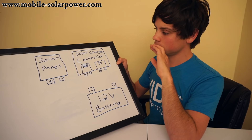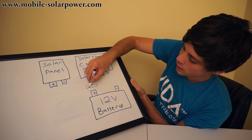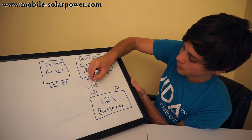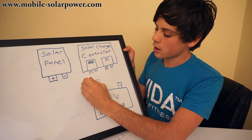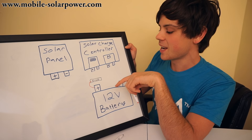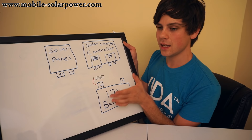In most systems, before you hook up anything, you want to have a fuse. A fuse is a tiny wire that when a lot of electricity goes through it, it will tear itself apart and blow. When you hear that a fuse blew or a circuit breaker blew, that's what this part is. You want to put this on the positive terminal of the battery. I recommend putting a bolt-on fuse on the positive terminal of your battery. That's the easiest, safest way to do it.